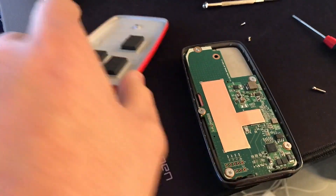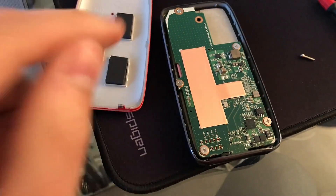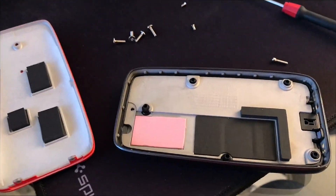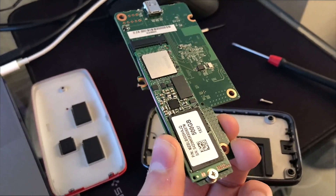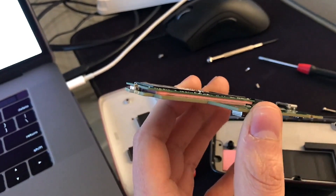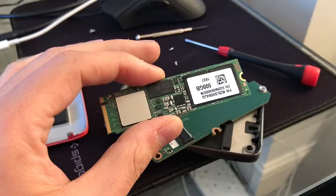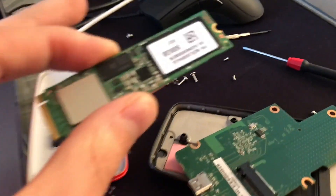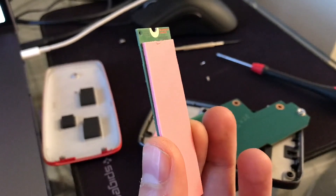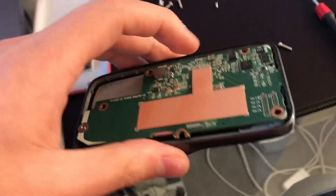Remove those screws and we get to here — this is what you see on the inside. The bottom has a bunch of screws to remove, again just normal Phillips heads. Once those are removed, on the other side we have the 500-gigabyte drive already in there, and that big piece of metal underneath it is the heatsink. The drive is held down with a screw and there's some adhesive heatsink material underneath it. This adhesive was very tricky to remove — I was worried I might snap the drive at one stage because it was stuck on so hard. But we managed to get it off, and now all we need to do is put in our Samsung Evo in the same slot, peel off the adhesive and stick it onto the Samsung Evo.